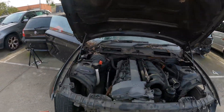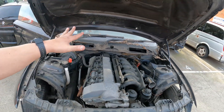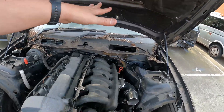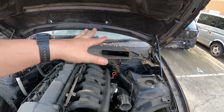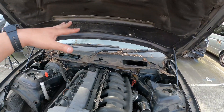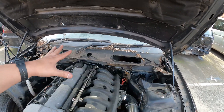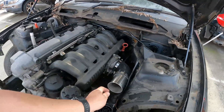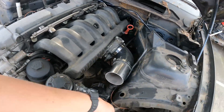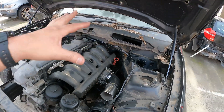Now we've got the engine wiring under control. Keep in mind we're only trying to get the engine running, so this isn't the final stage. We've organized the loom — it took a very, very long time neatening up all the wiring and relocating everything, because we want to keep as much of the loom out of the engine bay and away from all the heat. We've got the little intake pipe done with our idle valve pipe, and now we have the wiring here for the airflow meter, so we'll get to that.